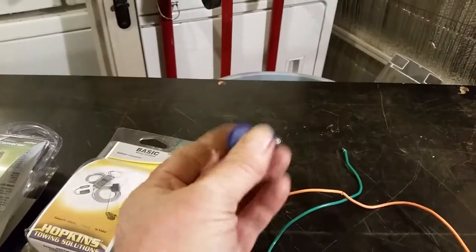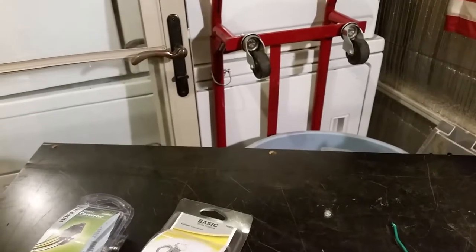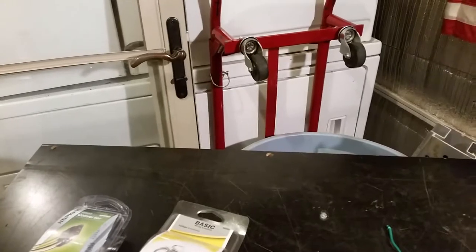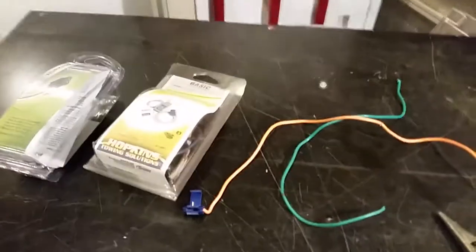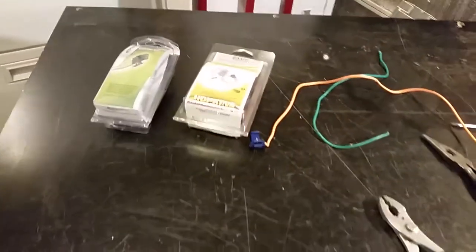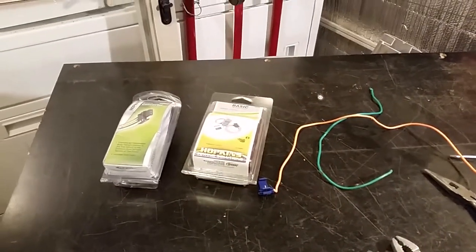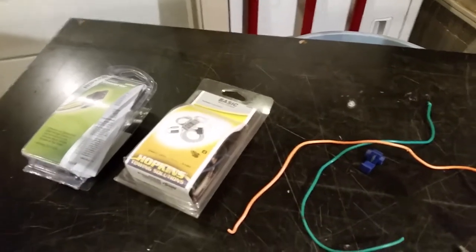The way I figured out what wires to clamp onto with these — the way I did it originally was I just took my tail light apart and checked what color wire it was, then went back in the fender and found that color. Nowadays you could hop on a forum site or look it up in a technical manual online. But that's how we originally hooked it up: took the tail light off, traced the wire, figured out the color, traced it back, and clamped in using these splice connectors. I think that'll do it, guys. Thanks for watching.